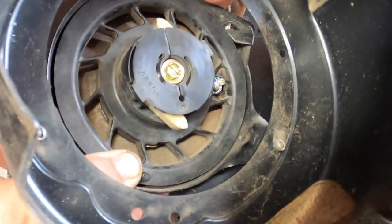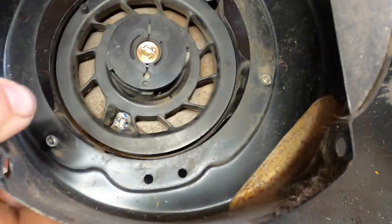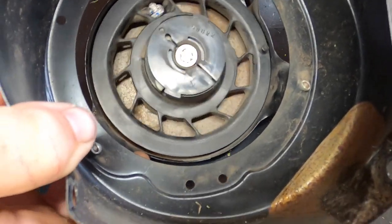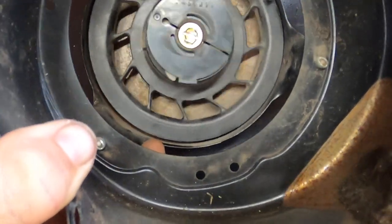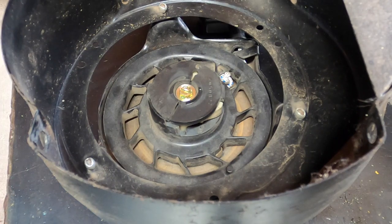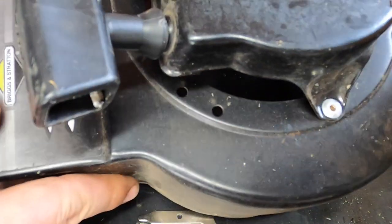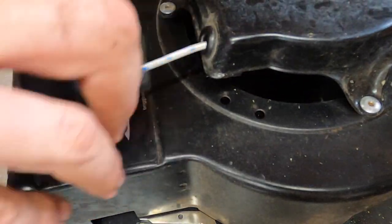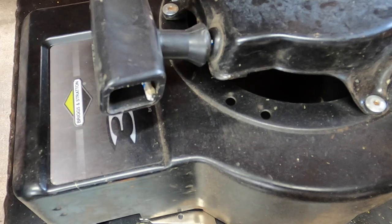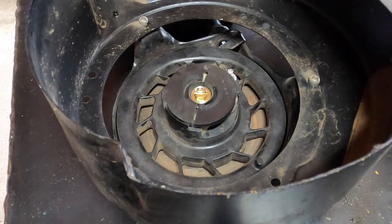There you have it — done. Now when you let go, you want to do this slowly. My hand is on the line — slowly feed it back in. If you go too fast, the handle can rip out and hit you in the face, or something bad could happen to the spring. And now you have it — look at this. It retracts nicely, everything's good to go.